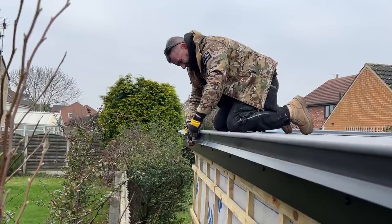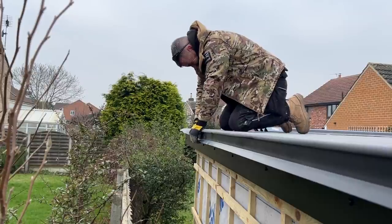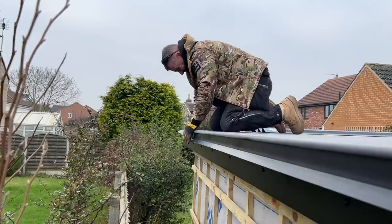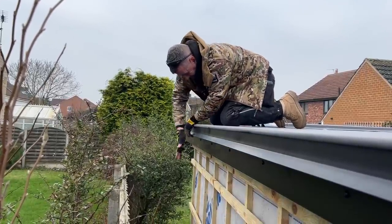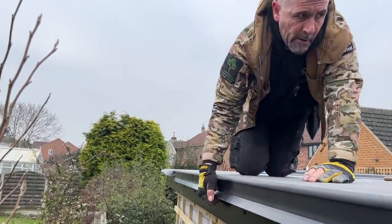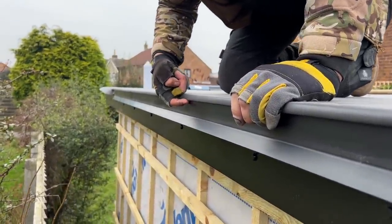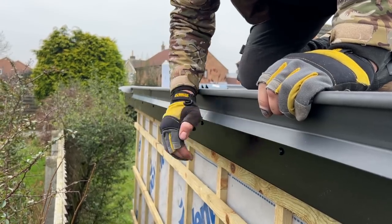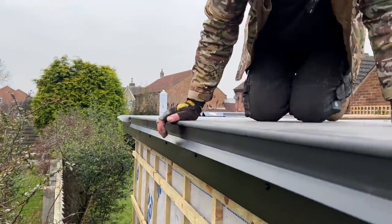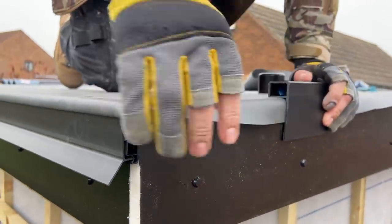What I started doing when I first started was belting it for dear life, which was great in the summer, and then come winter I realised that was splitting it because I was hitting it in with as much force as I could. So I found out — little taps, just tap it in like that, working your way along. That's where the seam is on the rubber so I'm just going to work on that a little bit more carefully. There, that's your first piece in. Have a little feel — make sure it's not popped off, which it hasn't. The silicone spray worked absolutely fine.